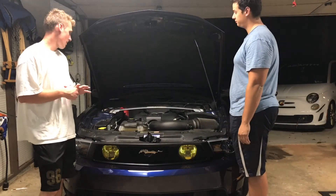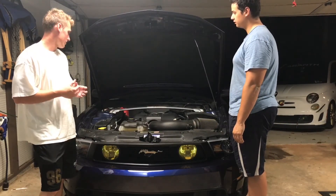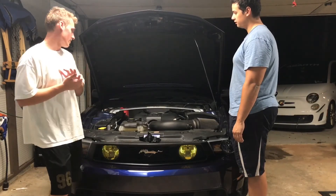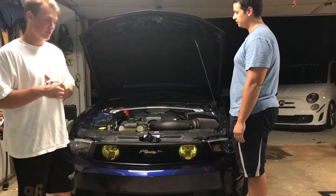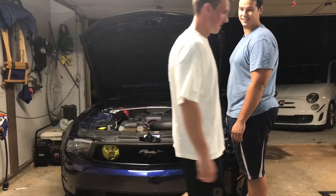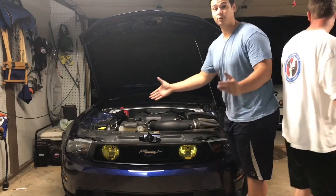Anything to say? No, I think it was all good. We've got them all torqued up. Got the coil packs and the boots back on. Now the engine cover, strut tower — and now we just got to crank it, make sure it cranks. That's a wrap.